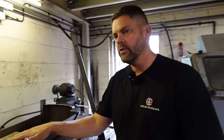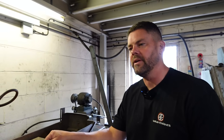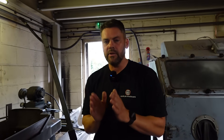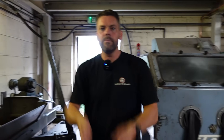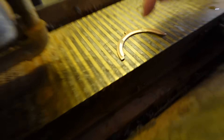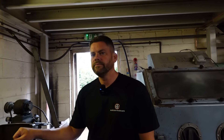These are thrust washers for a Cosworth — basically the same as a Pinto. Even visibly, thrust washers always look a bit rough and non-precision. You're aiming for a specific end float. The thrust washers go on the centre main cap, or the rear — sometimes built into the bearing, sometimes separate like these. Two go in the cap with a tag on top to keep them located, and two plain ones go into the block. We tend to aim for four to six thou end float; the limit is about nine thou, so you want to be lower. I try and aim for under five thou — perfect.